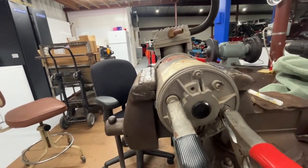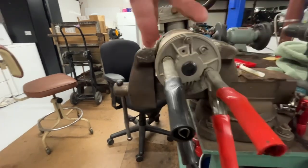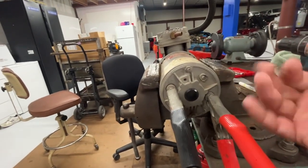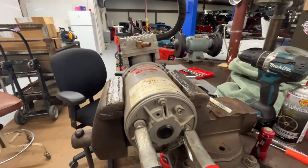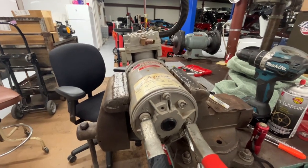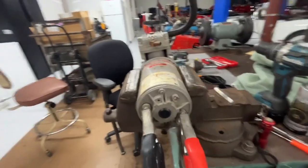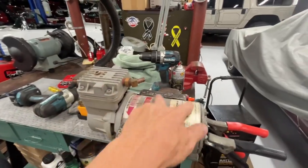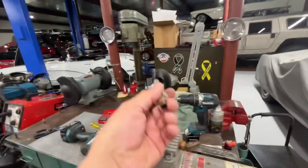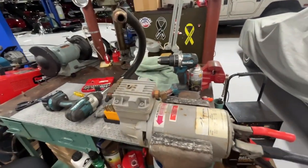Most motors are pretty hard to put brushes back in — they have pinholes or whatever you have to pop them. This one was easy. You just grab each one on each side; there's one on this side here, one on this side here, and just pull them back and shove it back in. The whole repair took maybe two minutes to fix, and then maybe ten minutes of detail cleaning. Getting this whole unit in and out, it just has two big hose clamps on it. This comes loose here, and this is your intake air, which actually goes back to the air box so it doesn't draw in just air from the desert where these things are designed. I'm just going to do a test on it here.